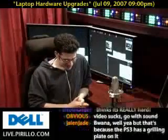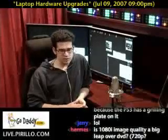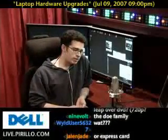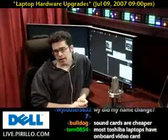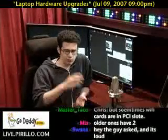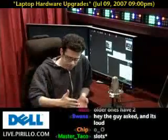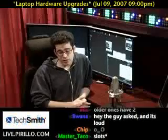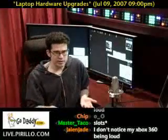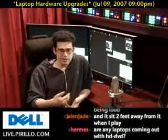To help with sound, I'm going to recommend getting a PCMCIA card. They sell sound cards in that particular form factor, and if it's a Toshiba, my guess is it's still got a PCMCIA slot. You could pick up a card at your local geek store or order one online and use that for your primary or alternative sound. You may be able to turn off your onboard sound in your BIOS or system setup screen before Windows boots, and then with a PCMCIA card plugged in, use that as your sound card. I've seen that used very practically — Jake Ludington and I would record audio on the road; he had a laptop but the sound really sucked, so he bought one with different jacks and the software support we needed.